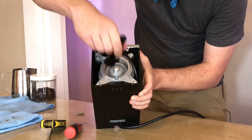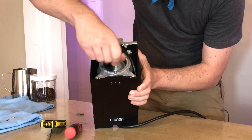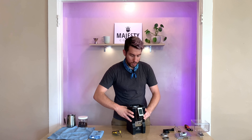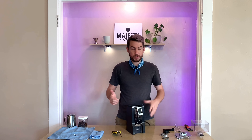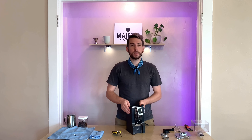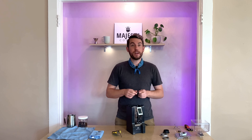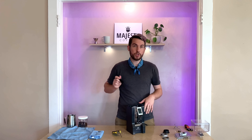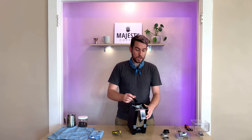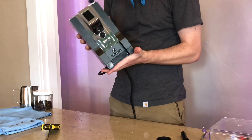Go in with our vacuum again and suck up all that coffee residue. Looking pretty clean down there — looking pretty good. Before reassembling, I just want to quickly clean out the chute. There is a declumping mechanism in there, so you don't actually want to shove anything down in there, but if you can run some compressed air through it will clear out any blockage. Look up inside the chute and make sure there's nothing blocking it.